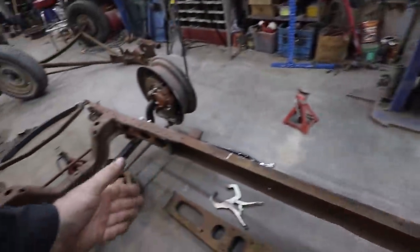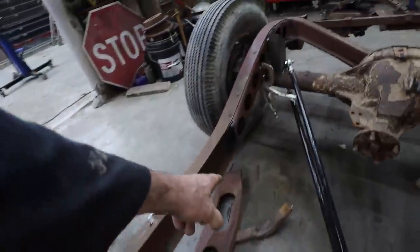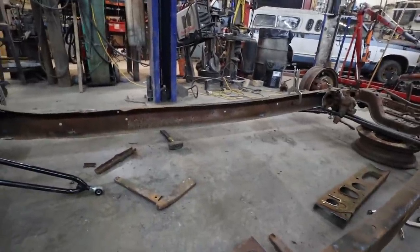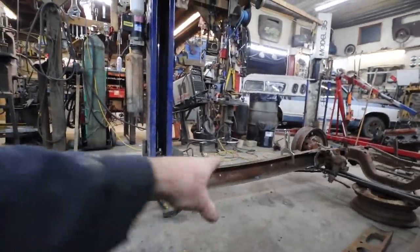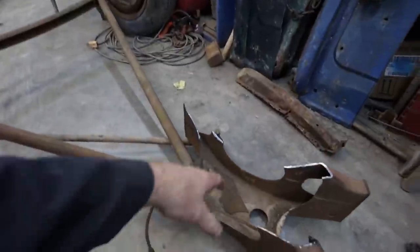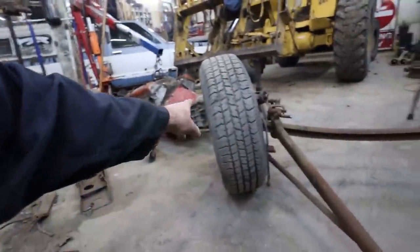I'm actually going to, from where it originally sat, which was like over here, but it was hitting all my stuff, move it back, to which we'll bring this back up into here, and then it'll close into these particular ladder bars, which will work much better onto some frame dealio that I got. So the chunks that I have over there, I'll probably just use them to box into the frame a little bit, and then I can tie into the X here, to which I might make it like this one that I had done where I had got the removable top, because I'll probably make it so the tail section of the transmission's in there, and then I can kind of use similar to the original mount-ish for that transmission.